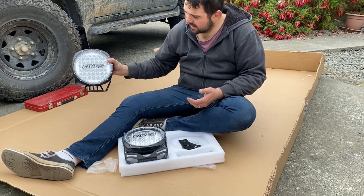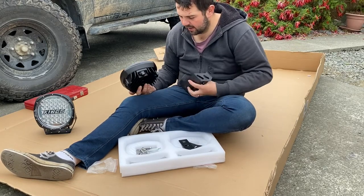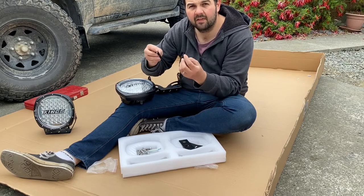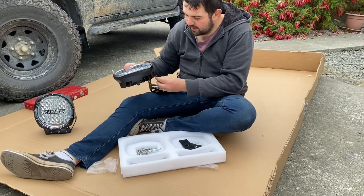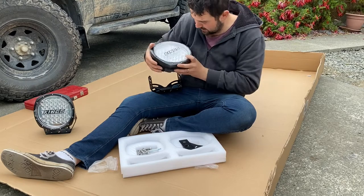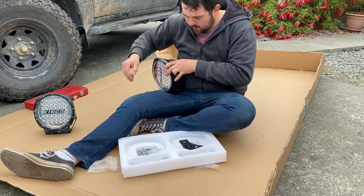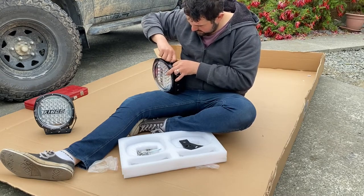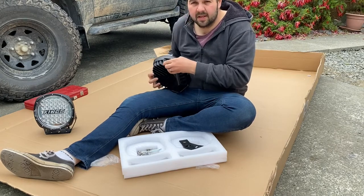So there you have it — that's how you assemble that. In case you didn't quite catch it, I'll run through it again. You've got your light and your mounting bracket. What also comes with it are some plastic shims that go between the light and the bracket, just so you don't get any unwanted metal-to-metal contact rubbing. The best way to assemble this is to put your bracket shims in place, slide the light onto your bracket, and get one of your mounting bolts. Don't put the washers on just yet — it's a little bit easier that way so the plastic shims don't pull out. Put one on each side loosely so it won't pull out.